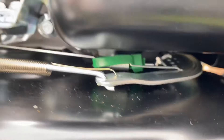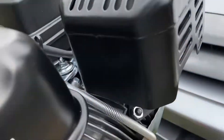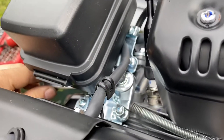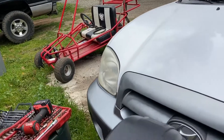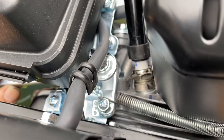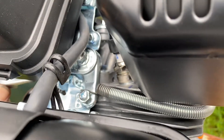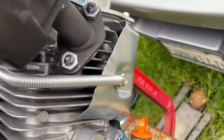The other thing that I did is I modified an old spring I had lying around. A lot of people were saying when they installed it on go-karts — this one's going on that Yerf Dog — it's that return spring. So I just heat up the end of it, kind of stretched it out, put it in that little crotch there, and then sprung it around so it's bolted to the heat shield bolt.